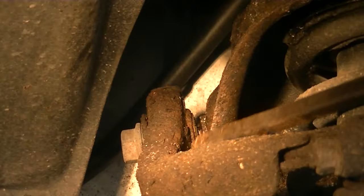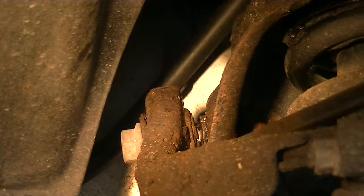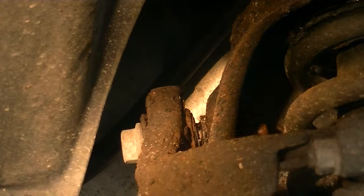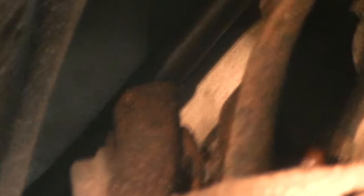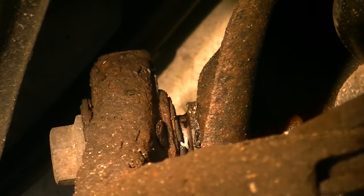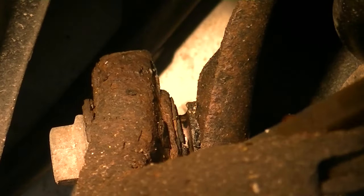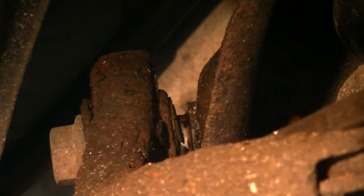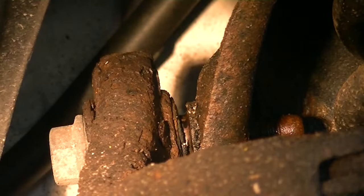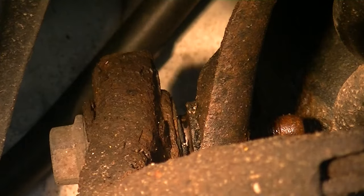I've got a pry bar here, and I'm going to kind of go in here — check this out. See that? This is the root of my swaying on the highway. If I zoom in just a little bit more, you can probably even see the bushing where it's damaged. Look at that. You can see the whole arm moving. So I found the root of my swaying on this trailblazer. If you have an SUV and you're having the same problem and you've checked everything, don't overlook these bushings. They go bad more often than you would think.